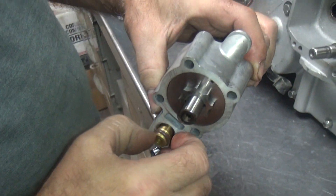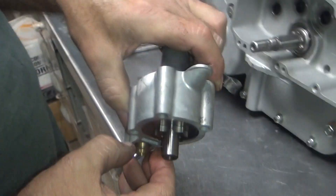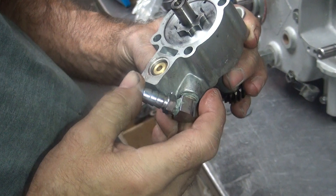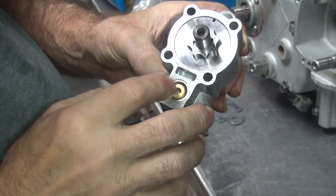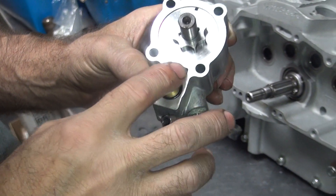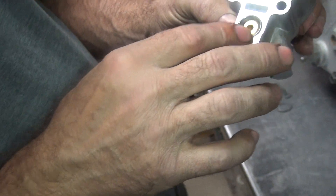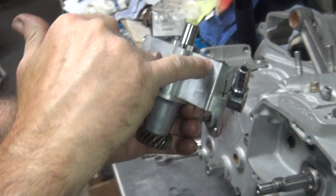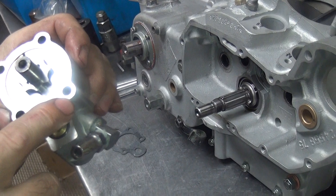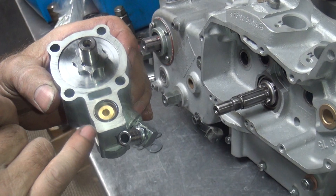I don't know which side goes in first. It goes in upside down, it's already cool. There it goes. Is that some kind of check? Let's check though. So when you put this O-ring in here, you want to make sure this black O-ring is sticking up above the gasket surface, or it will never seal. So if you use those thin Evo ones, it won't seal.